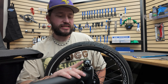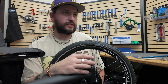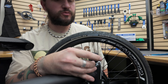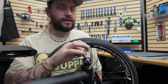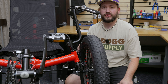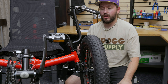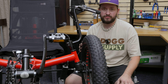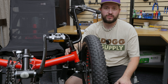On the Azub with indirect steering there's no handlebar here, but you'll have accessory options — this one has a fender mount clamp. It'll either be a clamp or some spacers, but it's the same process as Cat Trike: loosen the clamp, tighten down the headset, tighten the clamp back up. Replacing the bearings on the CXS is very similar to Cat Trike — we actually have a video where we upgrade the headsets to our Revolution upgraded headsets, which also explains in depth how to replace the bearings on the CXS.